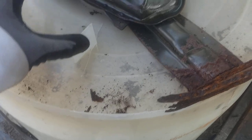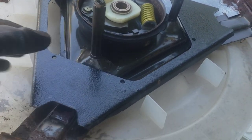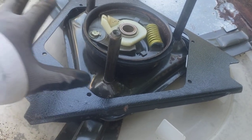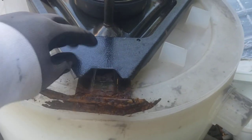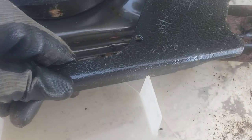I think it's because of these fins. Let me show you how it may have happened. This is the tub and this is the balancer. If you ever transport a Whirlpool washer on its side and it's off balance, a lot of times the balancer ends up like this because the tub shifted sideways during transport. When you put it back upright it stays misaligned, causing the machine to bang — boom boom boom. Make sure the balancer is lined up with the metal.